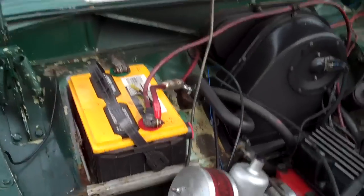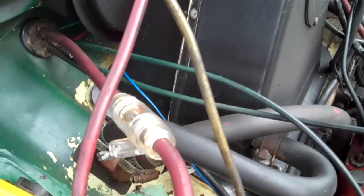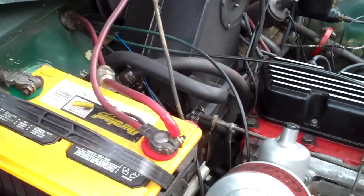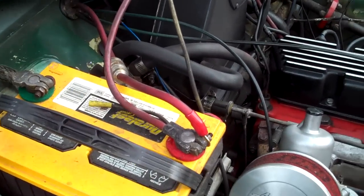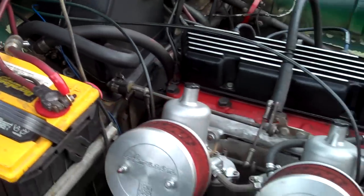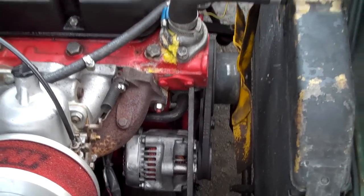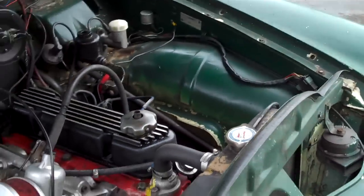Actually first, I'll show you how it's powered under the hood. Driving the amp, you'll see, is this wire here. I've got a big heavy-duty fuse there to keep everything hunky-dory — don't want to be starting electrical fires. That would be bad. Pretty big battery; it's got 800 cold cranking amps. Pretty heavy-duty alternator too. It doesn't look very big, but it puts out enough juice to keep this car running while I'm driving and rocking out.